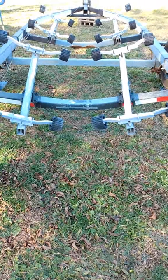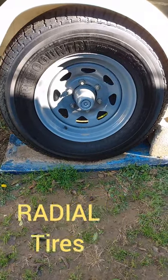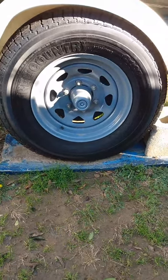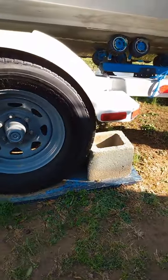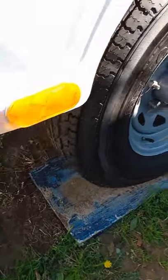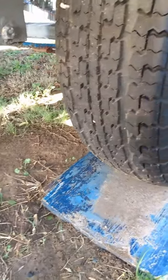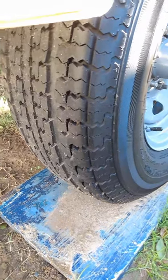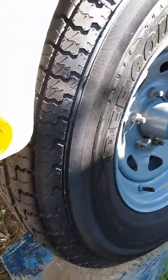So what do we really need to know? We need to know that radial tires run cooler on long trips — that's why I put new radial tires on my main boat trailer. They're also less prone to develop flat spots when parked in the same position for long periods of time. Now, bias ply tires have stiff sidewalls, so they are advantageous for carrying heavy loads. Stiffer sidewalls on the bias ply tire also help reduce trailer sway.